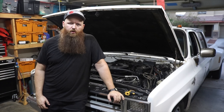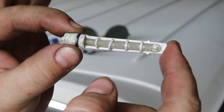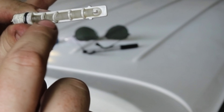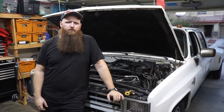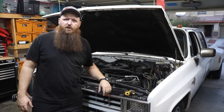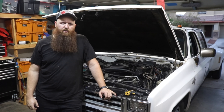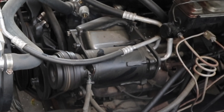I've already made an attempt to make this AC system work. My dad came down and we pulled the orifice tube out, which was installed backwards. This is the part that should be sticking out, but they shoved it in so hard you can actually see where they broke these two ribs off trying to get it in the wrong way. We used a lot of air pressure to finally get it out and it ended up bouncing off my dad and going up underneath the cowl onto the windshield. We put a new orifice tube in and fired it up, and the AC pump started smoking immediately.